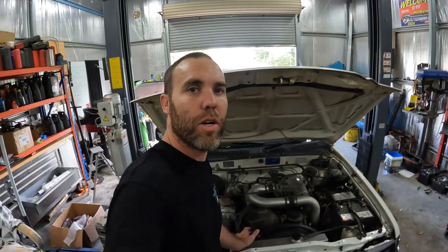Basic rundown of this car: Tuna Racing log manifold, PSR 3076 Gen 2 with a 0.82 rear, 450x300x76 intercooler, two-and-a-half inch intercooler pipes — all alloy and silicone, no fancy clamps. Thousand CC injectors; if you watch Episode 5 you'll see how to do that. Almost everything on this car is available through tunaracing.com.au — check out what we have. We do the manifolds, turbos, fuel rigs, injector cups, and we're always adding more so check back to see what's new.